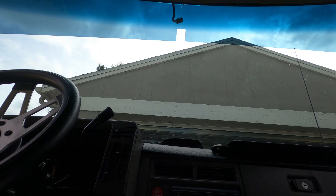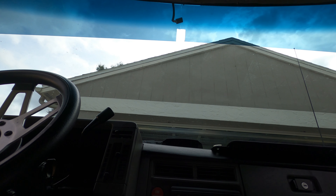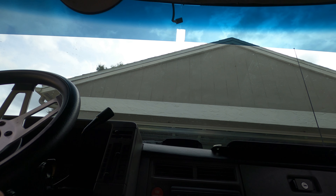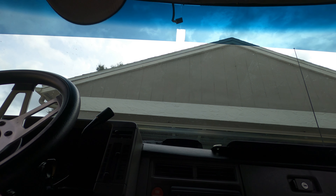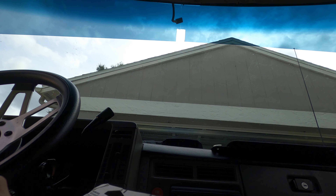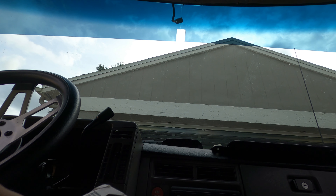I'm going to do the easy job first and glue the rear view mirror back on — fix this for the hundredth time. The old adhesive is still up here. If you're doing this yourself, make sure you scrape it off really well. Once it's scraped off, make sure you clean it really well. Otherwise the new stuff will stick for like five seconds and just fall right back off.